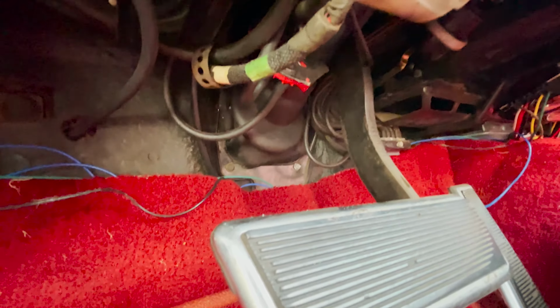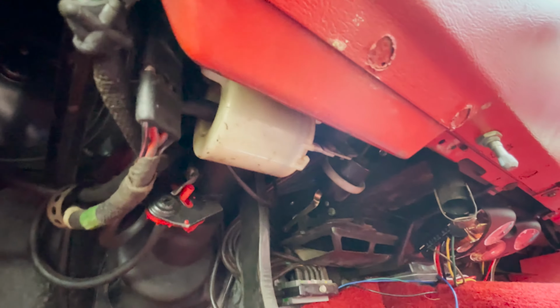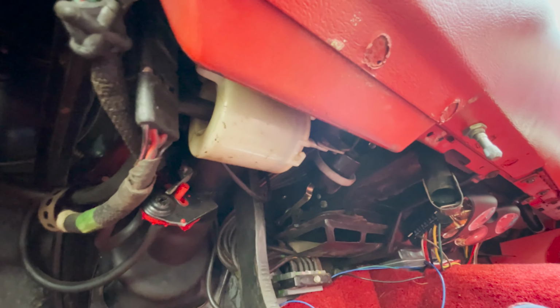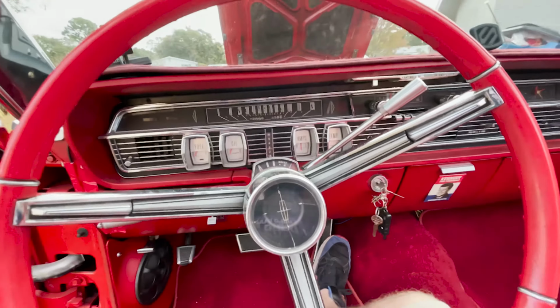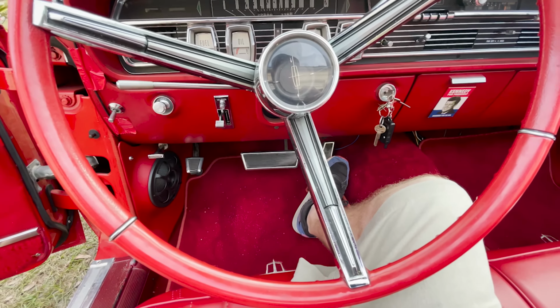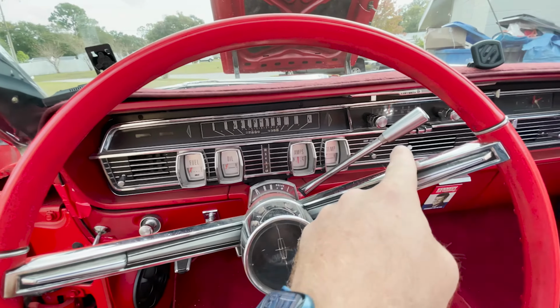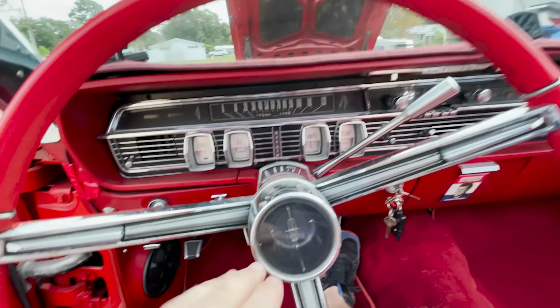You see that big boot, as I call it. You have this white part right here, and that's doing the work, okay? So you push the button on the lever, it activates the solenoid, you've got your vacuum built up, and then you can basically move the column up or down. And then when you let off of this at the end, it's going to lock in.